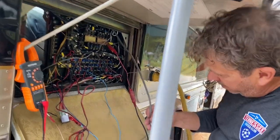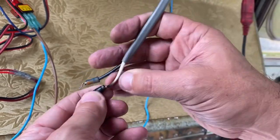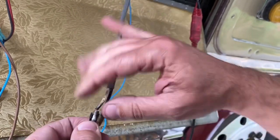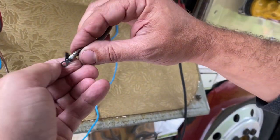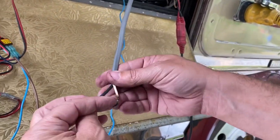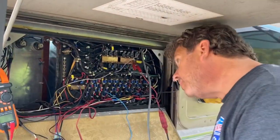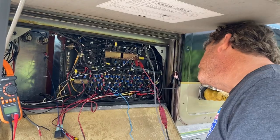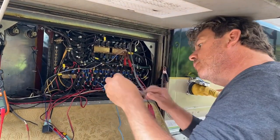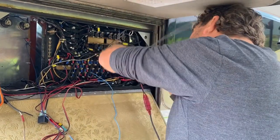Yeah. Okay. God, look at this, man. You almost had a. That's custom coach, right? Yep, exposed, and that was bumping against something. Of course, the way they tried to deal with it was by putting... Look at that. It just got so hot, it was burning. Yep. Yuck. Never like to see black charred anything inside a control panel. It's good we got this out, brother. Yep. What we'll do is we'll cut these and put a wire nut on both of them, and tape it up and just put it up like this.